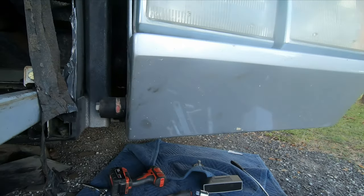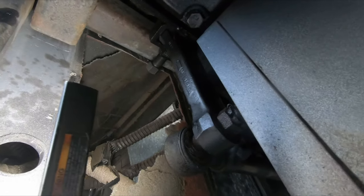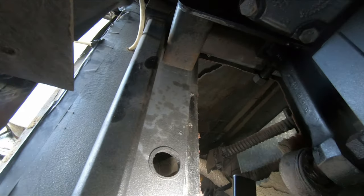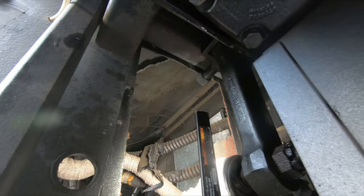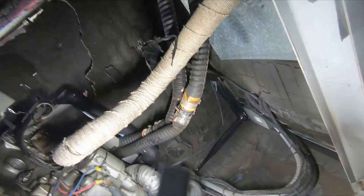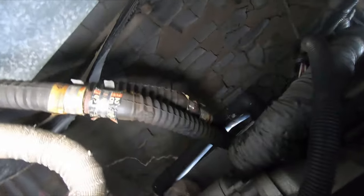As these things go, one job turned into two. What happened here is I have the puller up on there, and I was not able to get it off. So I'm looking around, and I see all these square head screws here, and I thought, huh, somebody's been in here before. So I took the time and effort to get in here, and lo and behold, I opened the generator bottom for the first time. And now we have all the clearance we could ever need. And my generator coolant hoses definitely need replacing. And that is the oil leak I've had for a long time.